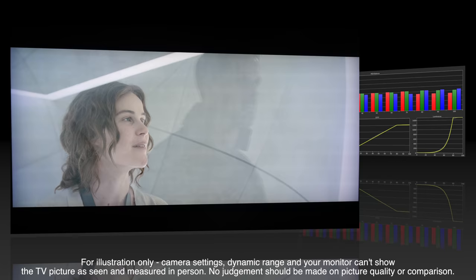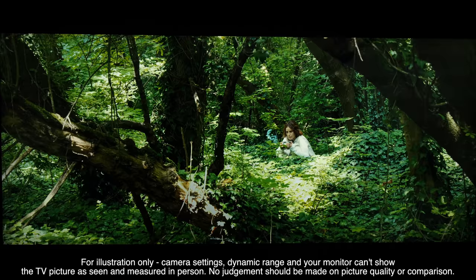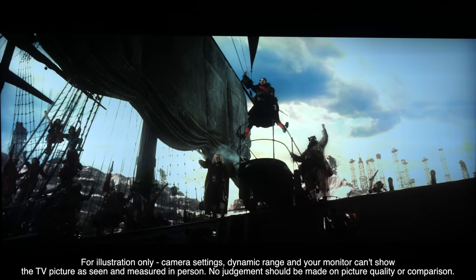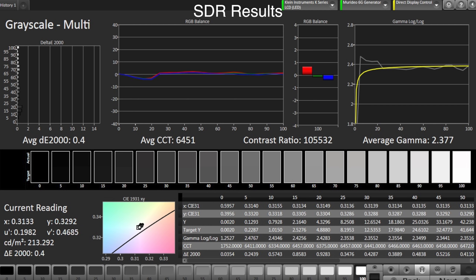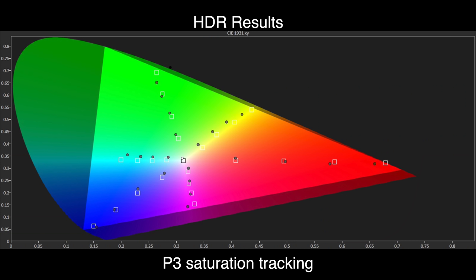What we can accurately measure is the actual in-image performance with the dynamic tone mapping, which cannot be defeated. After spending weeks watching the set with familiar HDR content, there's nothing untoward going on within its images that makes it look too different from any other HDR set. In terms of image accuracy for SDR the Samsung Q90R is excellent when set up correctly out of the box and even better when calibrated. In HDR we also don't have any major issues apart from the slight PQ EOTF brightness, which we hope Samsung will fix in movie mode, and which can already be corrected via a slight contrast adjustment.